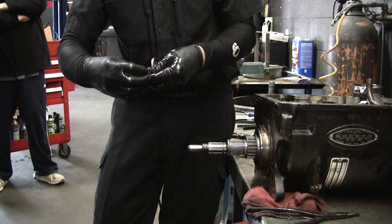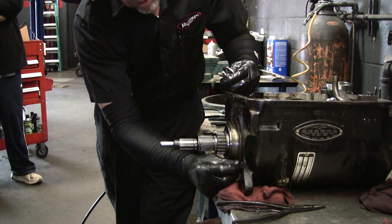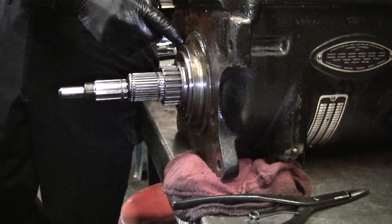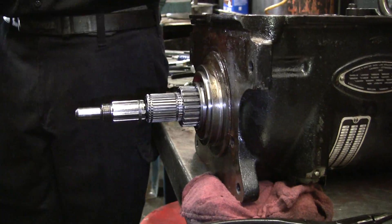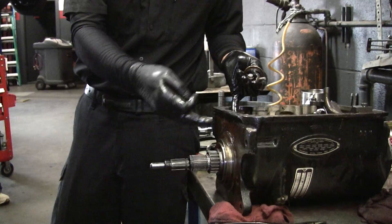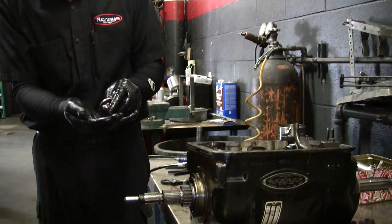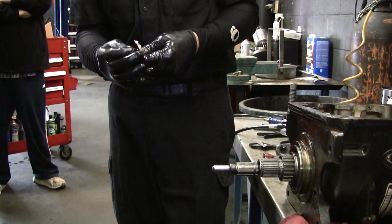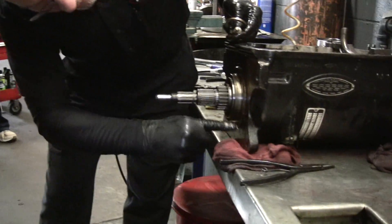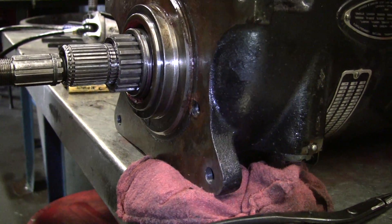On one of the holes there is a step-down shoulder that's bigger, and there's a washer that goes in there. What that does is it's indexed into the outside part of this pump housing to keep that from spinning — or at least to put it in the right position. There's a cutout on this outer flange which I'll show you when I get it off, so the washer seats in that and it's in the right position.